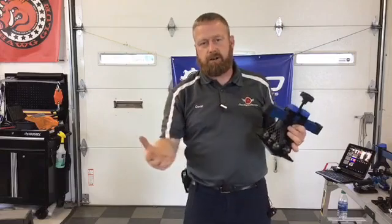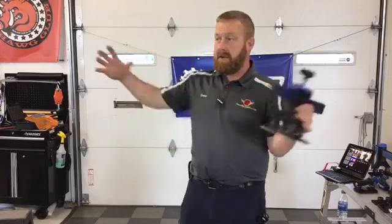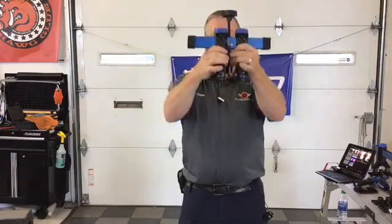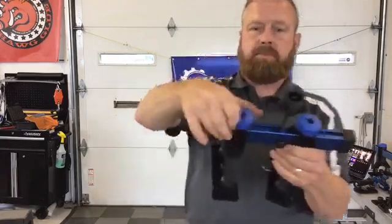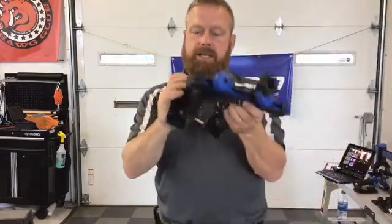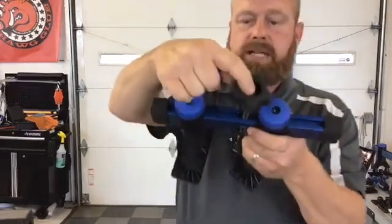Those panels are difficult to move. You're forcing them to go, and a lot of times you're wasting a lot of energy drawing all of the rest of the panel around. Being able to bring these feet in and hold the metal down right around your tab really lets you concentrate that pull. We've got the same feet that roll in and out. These feet also pop off if you want to switch to the kidney-shaped feet, and there's the 1/4 inch adapter on top.